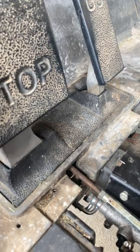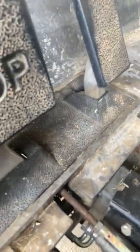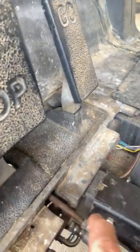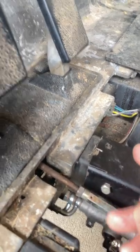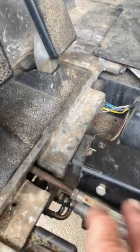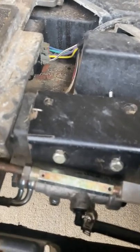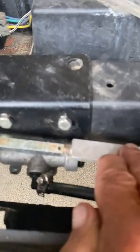What they really don't show you is the best way to do it: there are only four bolts in this brake assembly. You can take them out and just flip it over to the side — there are a couple of electrical wires you don't even have to take off — and that gives you room to get in here to work on it. It really is hairy right here.